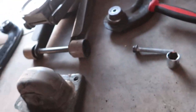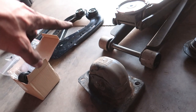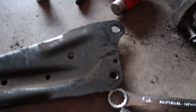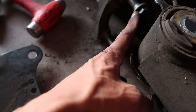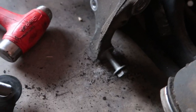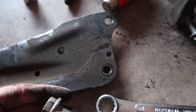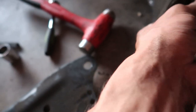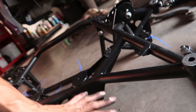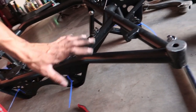Someone can buy these. I also have subframe inserts I've gotta dig out that will also be for sale. These caps seem to go onto the new arms and they are directional. Here's something interesting: these two bolts are the same length and same head size, but this one has a lip on it that actually goes in and centers this top piece — it slides into there. So if you guys are ever doing this, make sure you're putting the right screws back where they came out of. The book says to mount the diff on the subframe, get it up and centered, and then I'll go from there.